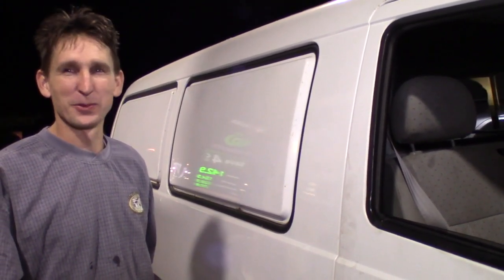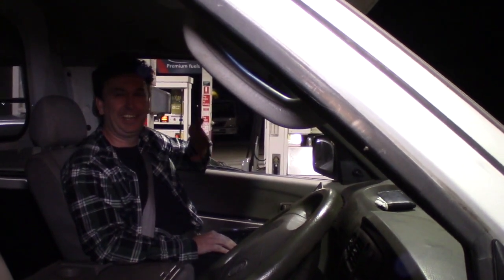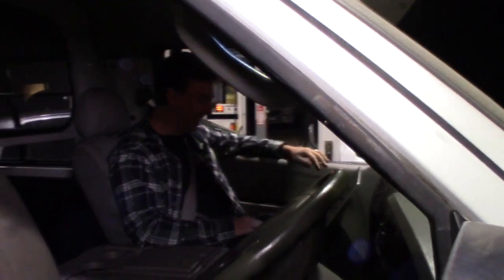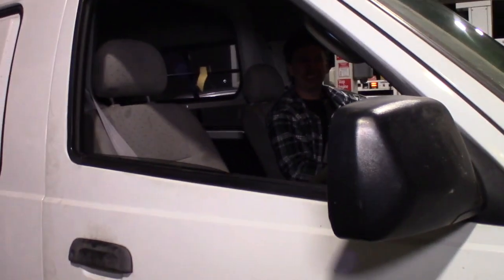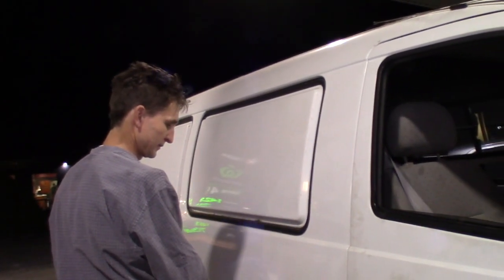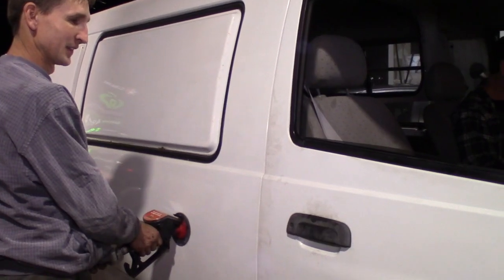Number one, this is going to be a frequent occurrence for a V12 powered van with a 60-litre tank. So, how are we doing? We're all right. We're lean under throttle and rich at idle. So we need to switch it around. Gotta swap that around. All right. We're getting there. I only put 29 litres in, I reckon. See how many we burn on this next trip.